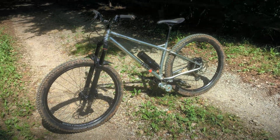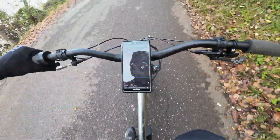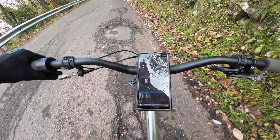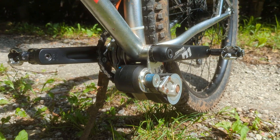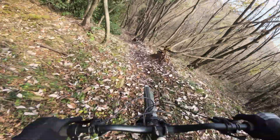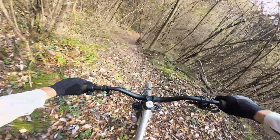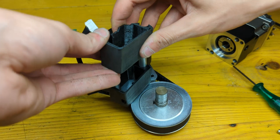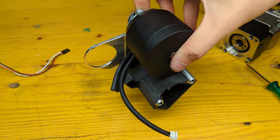Being this the first prototype, there are obviously some slight issues. First, the motor overheating — probably due to lack of ventilation. It isn't that bad since the motor runs happily for about 20 minutes of climbing, after which it reaches about 85 degrees, causing the controller to limit power to around 400 watts. The other issue is that since the motor hangs below the bottom bracket, it's prone to getting hit by rocks — I've smashed it a few times quite hard, but it held up fine. The last potential issue is that the controller box is not waterproof.